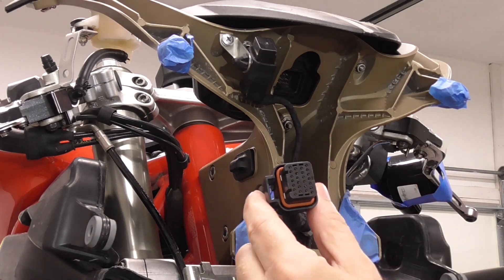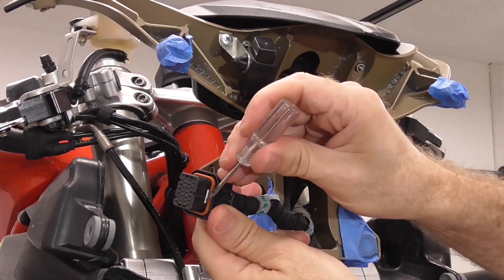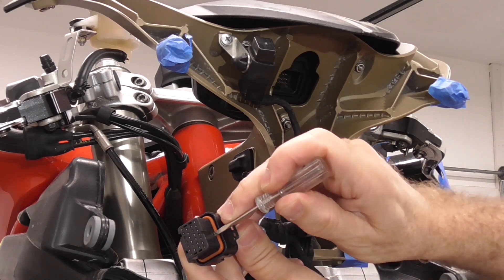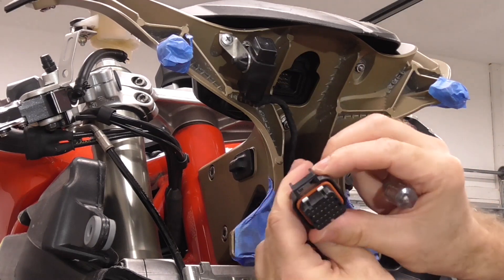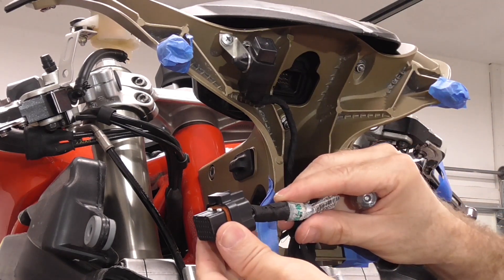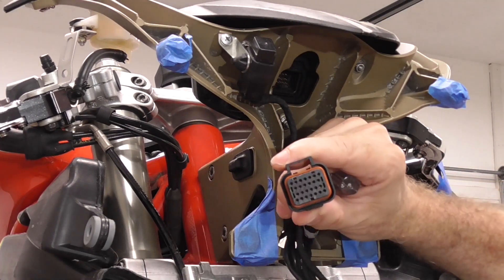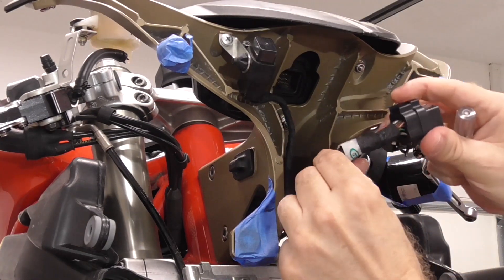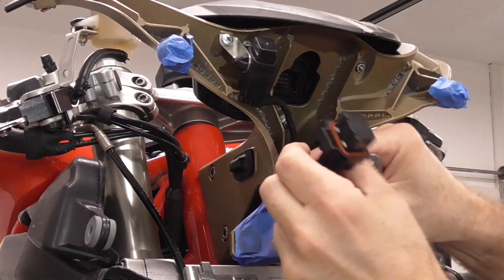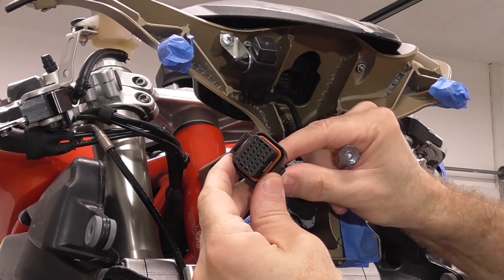These are really easy to unlock — you can pretty much do it with just fingernails, or a small screwdriver. There's a white tab here and two tabs on this side. Push this in like so, you'll hear it click, and you can see the two tabs on top are popped up now. That means this is unlocked and we're ready to disengage the pins. Once you get all the pins back in you can simply push these back down and they lock back in. First thing I need to do is get some room to work — I'm going to take some of this sheathing off, unwrap it back a few inches so I can grab hold of these pins and pull them out.